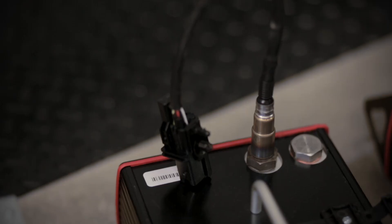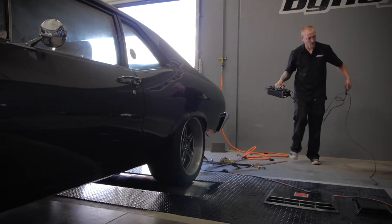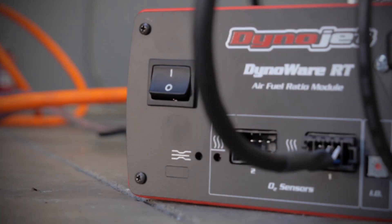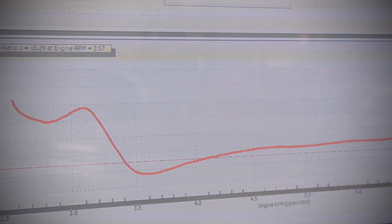The DynoWire RT air fuel system comes standard with one O2 sensor but has the capability of bringing in two air fuel inputs. You can buy an extra sensor through DynoJet when purchasing your air fuel system and monitor two at one time. Since DynoWire RT has expansion systems built in, you can bring in an additional three units, making a total of four pumps and eight sensors.